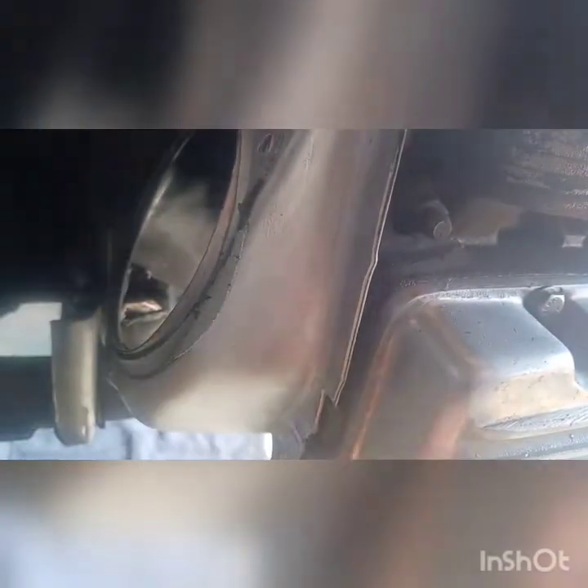Another thing was this rubber grommet on the oil dipstick — that's new because it was missing before. We also put on a hasp down here around the PCV tube that's going out. The biggest improvement was this plate here, added on both sides. Hot air comes out here and supplies the cabin heat, but there's a plate directing the air down through the engine and through the heads rather than right out the side. I'd say you were losing 40% of your cooling air just shooting out the back of the engine.